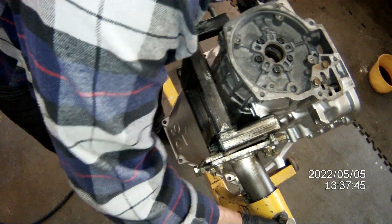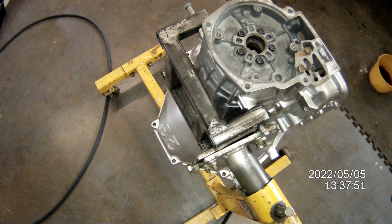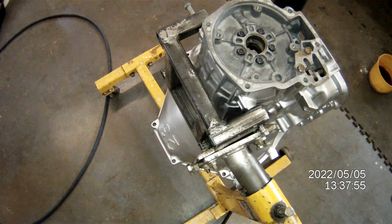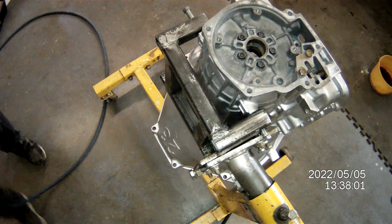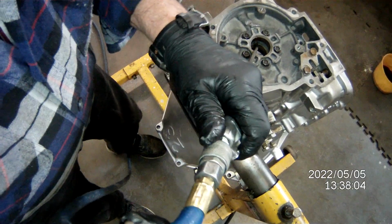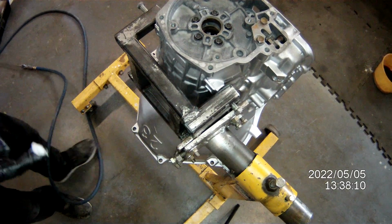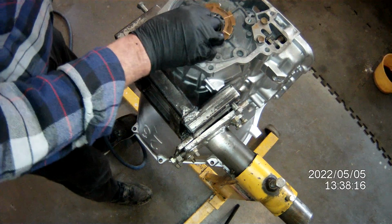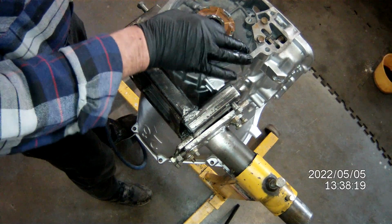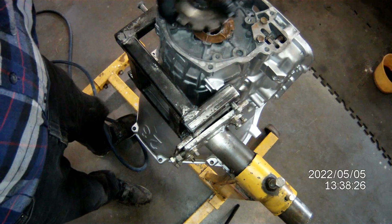Okay. Oh, make sure you air pressure check this here. That's good. Return. Hopefully you see that. You make sure that's clear, that's not blocked. A little dab of Vaseline on the back end here for the thrust washers, hold that in place. Ain't going anywhere. Most times these are staked in, but sometimes the stakes after you take them apart aren't much good anymore.